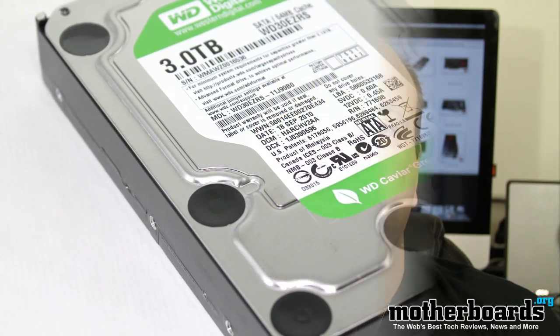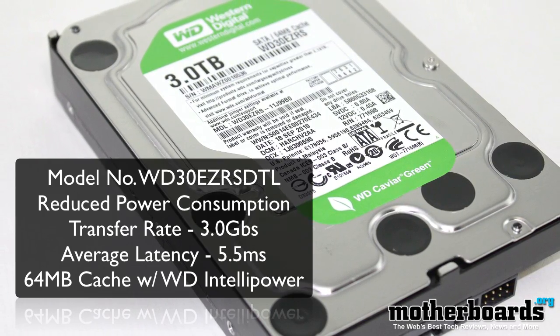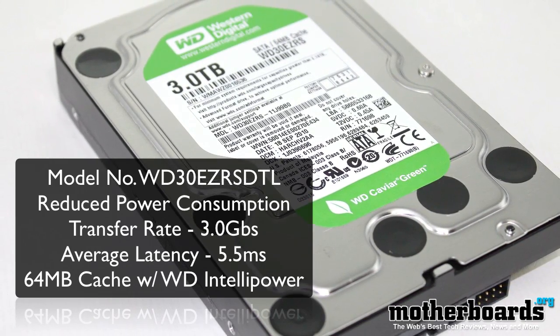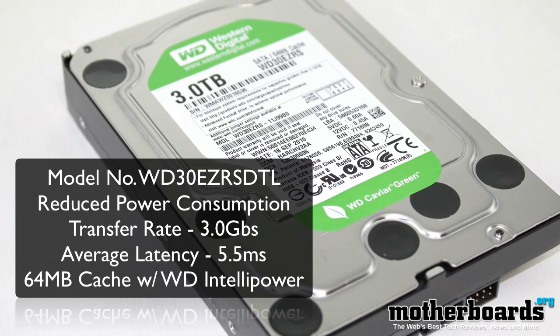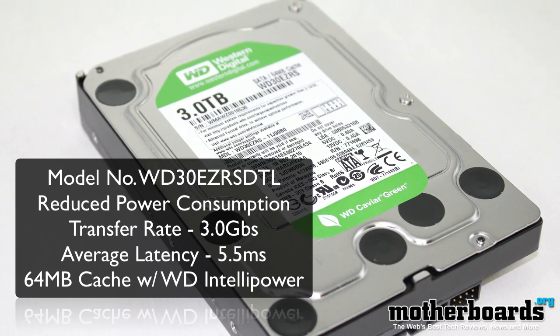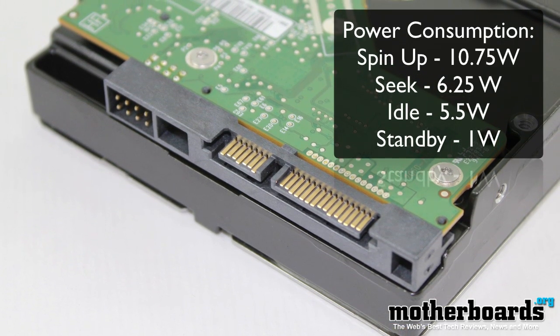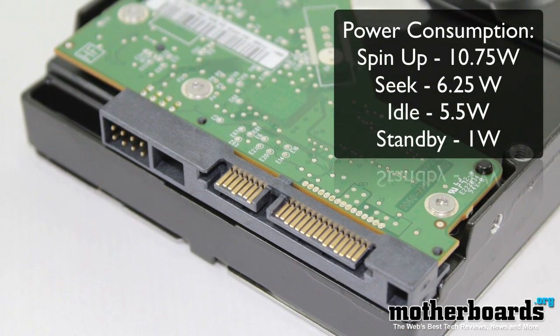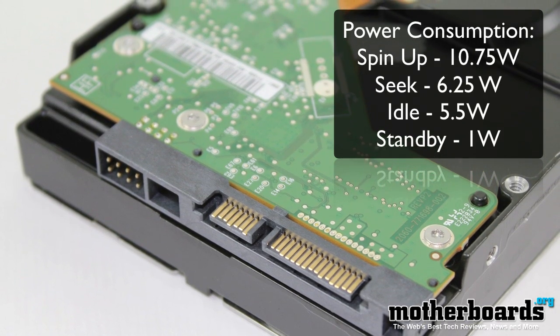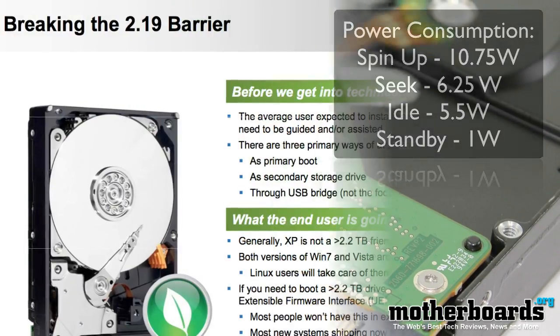Let's now see how fast this drive is, what its general features are, and at the end of the day whether it's worth your money. Some of the new features of this Western Digital 3TB drive are as follows: it comes with four 3.5-inch 750GB platters on a four-platter design. It also comes in 2.5TB and 3TB versions. It has a 64MB buffer at 300MB per second. The SATA interface speed is 3Gbps and the drive supports native command queuing. This is the fifth generation of the Western Digital Caviar Green product line. It also features advanced format and is 100% halogen free.